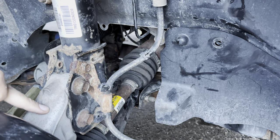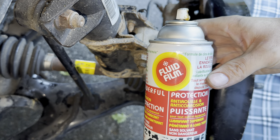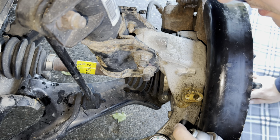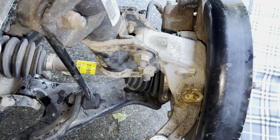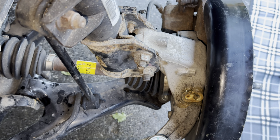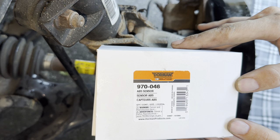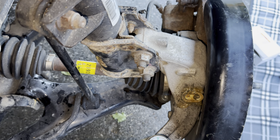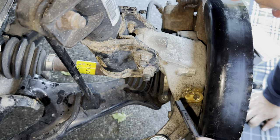Now we have to get to the back of the hub and unscrew it there. Next, I like to spray a little fluid film down in the hole — I lost my straw, but I'll try and get it in there. That'll prevent future corrosion. Now for our sensor, that is the part number for this — this is the passenger side front. We're just going to go ahead and put it back on in reverse of how we took it off.